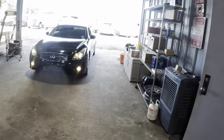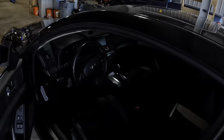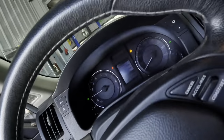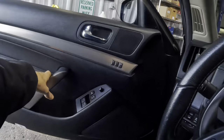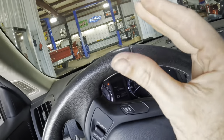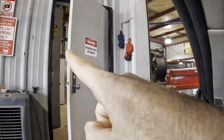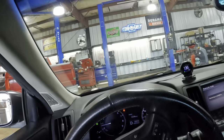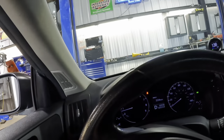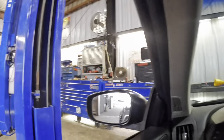Good man. All right, now we can use the little lift for the little car. We'll get those bushings set up. Now, the owner of said vehicle has read on the Infiniti forums that if you take the rear bushing and place it in the freezer, it'll shrink down enough maybe to make it press in with ease. So I do happen to have a freezer over there. It's next to the diesel heater. It is cold, so I'm not sure how effective that's going to be, but it couldn't hurt, and that's what he wants me to do, so that's what we're going to do.